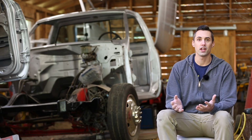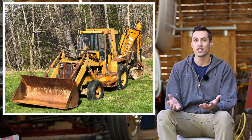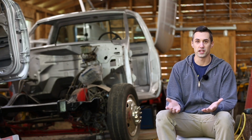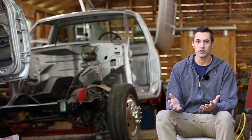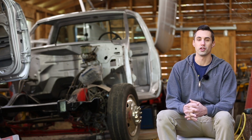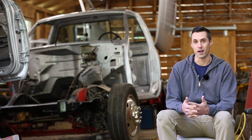My next full-length video will probably be on Dino, my backhoe. He has what looks like hydraulic fluid leaking into the crankcase. I suspect it's leaking from the gear-driven power steering pump, since I also noticed that the steering is heavier and the hydro boost brakes require more force than normal. I plan on removing the pump and disassembling it to see if I can repair it.